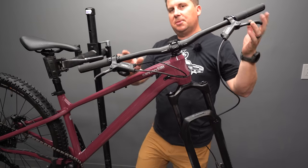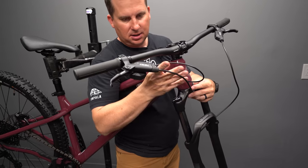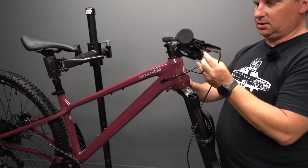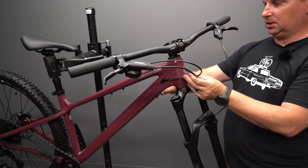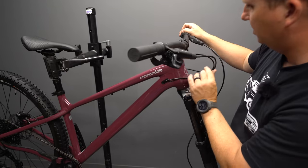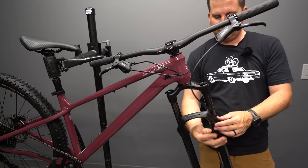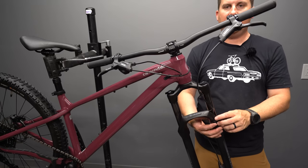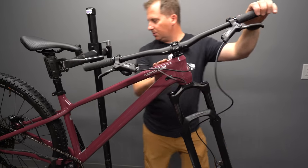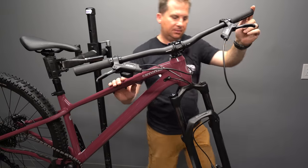Now, this won't affect most people because you're going to be buying from a dealer, but the cable routing's funky. It's kind of funky that this shifter goes in here and then the brake goes in over here. Usually those two stick together, especially because we're gonna have to run the dropper in there anyway. And then the front on the fork, this should be routed through here so it pops up in here. Not the end of the world for me. It just feels like, oh man, was someone not paying super close attention to this when they did it? So that's one small thing I would improve.